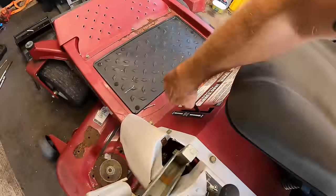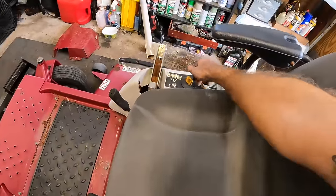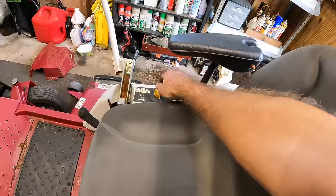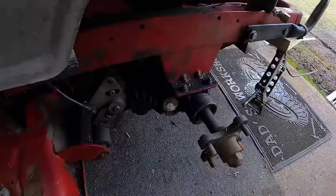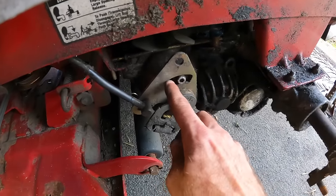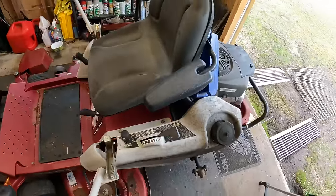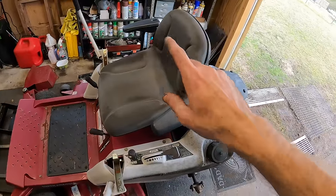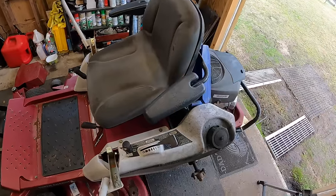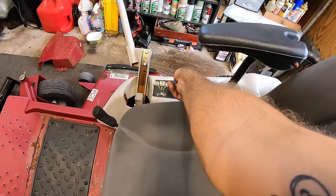and let's see, up, brake on, think we're in pretty good order now though. Also, because it's going to be loud when I crank this up, but you'll see now that this bolt basically meets up with the front of this when we go into the full forward position. So, and that's what the other one was doing. That way we should have full speed out of both hydros. So let's crank it.